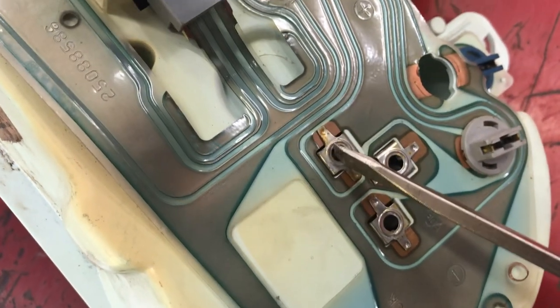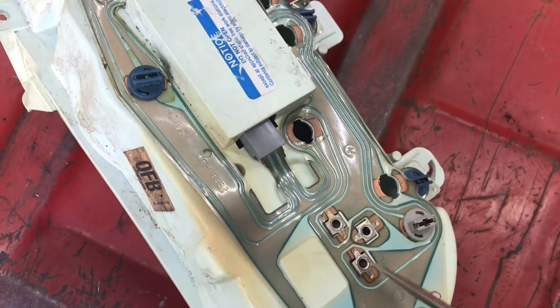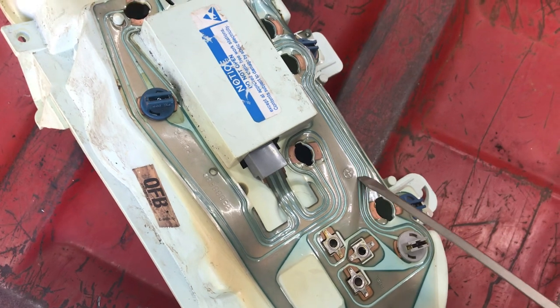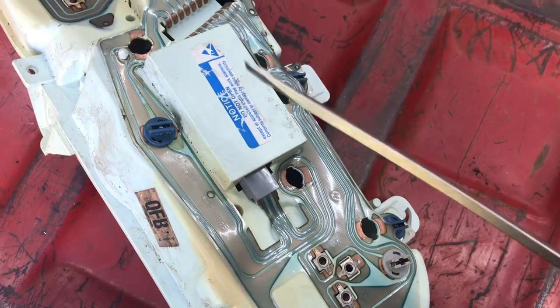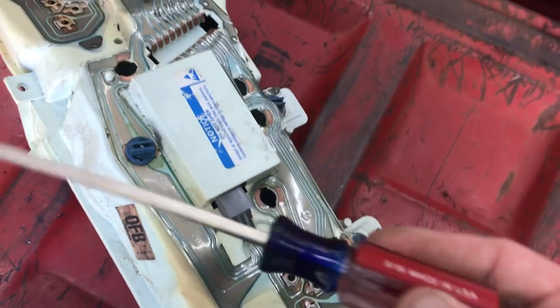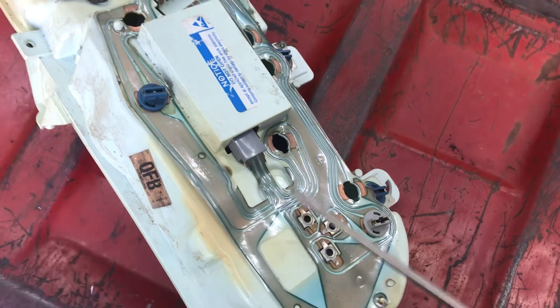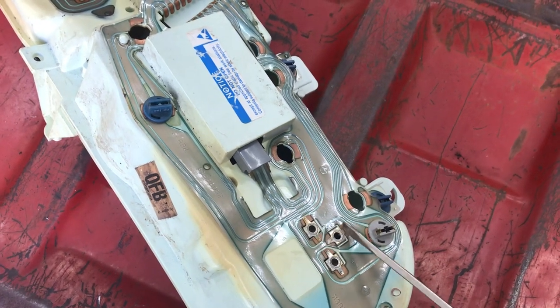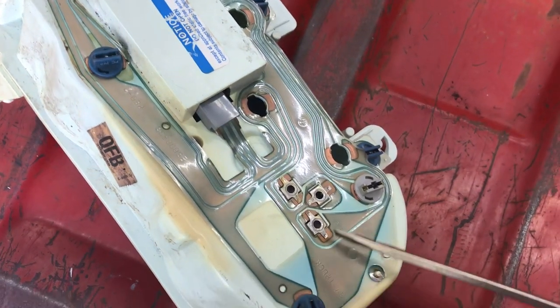In the past I've had to trace this board — this side would be for your fuel gauge wire, this is your hot. Sometimes you can have issues with that. I was having issues with my gauge wire because when I turned my switch on my gauge went all the way to full. If your gauge is sitting static — not moving — say it's sitting down here not moving, you may have a problem with your gauge, your hot wire, or also could be the board ground.